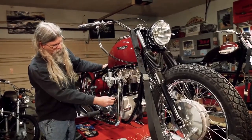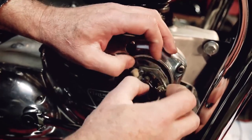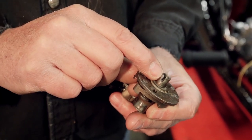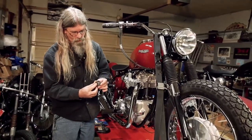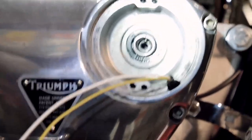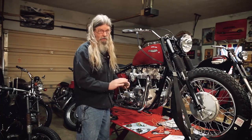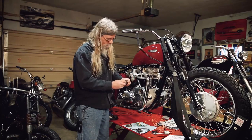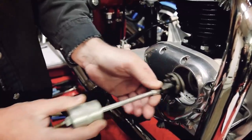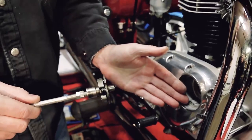You're just going to remove the two pillar bolts, top and bottom, and then you're going to remove the points plate. Once you take that center bolt out, on the back side of the advance unit there's a taper and there's also a pin in the end of the camshaft that locates with this slot. When you've tightened that center bolt through that advance, it kind of forms a fit because it's a taper. So when you take the bolt out, this isn't just going to fall off in your hands — you have to pull it off because it's kind of a press fit. You're just going to give it a little slide action and bang that against that bolt and it'll pull this taper out of the end of the cam, and that will remove the advance unit from the camshaft.